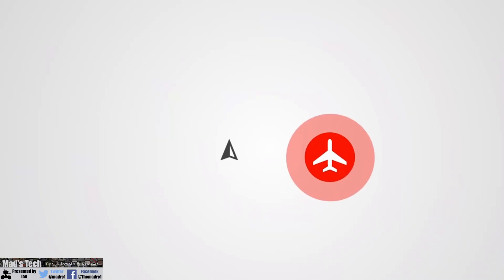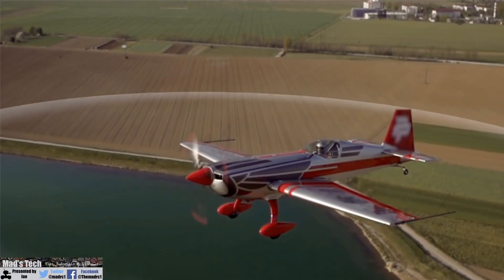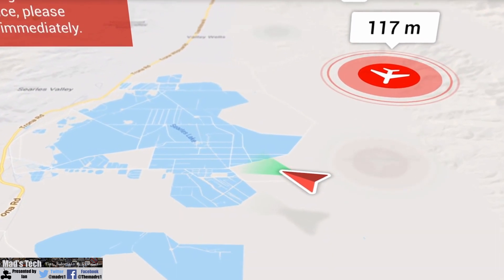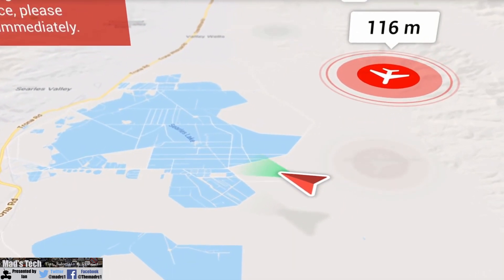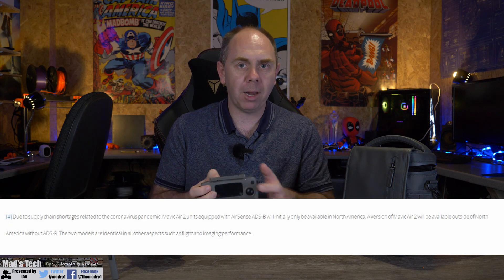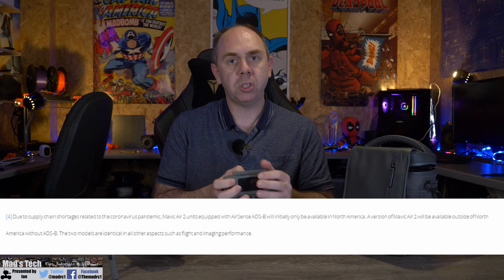As mentioned at the start of this video, there is something to be aware of regarding the DJI AirSense system. Last year DJI announced that 2020 models would include AirSense as standard, and whilst the Mavic Air 2 does have it built in, that isn't the case for every region. AirSense allows DJI aircraft to pick up ADS-B transponders from manned aviation — if an airliner flies above your head, its position will show on your screen. Whilst it has been integrated into the North America/US model, European models are not getting this, due to a lack of parts availability resulting from the COVID situation.